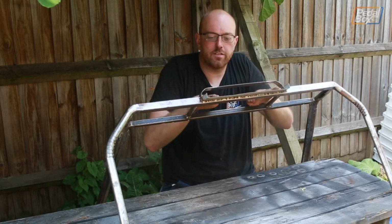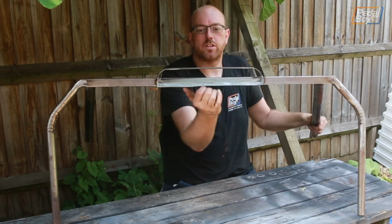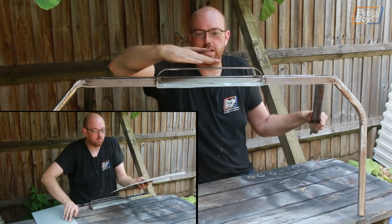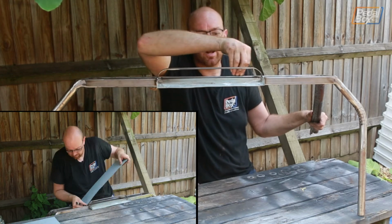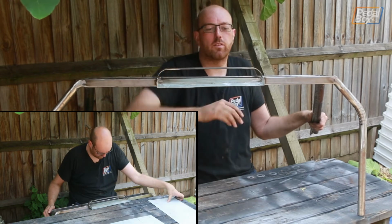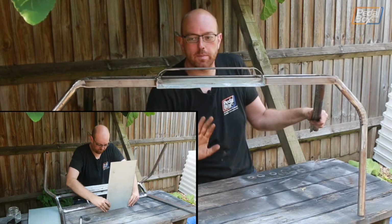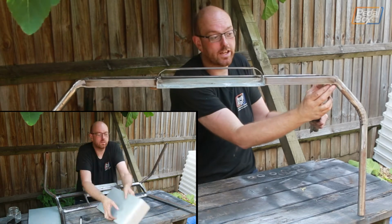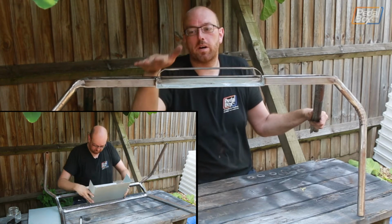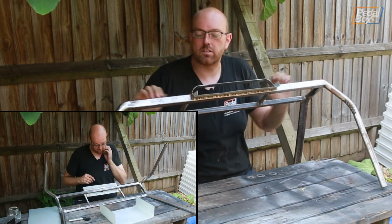Now we've obviously got the sheet in the very bottom here that you can see, and that forms the bottom edge of the scoop. Now, it's not completely flat where we've been welding through, but basically the top edge of this needs to come down and roll into the very back edge of this framework, and internally this needs to roll down, and this will probably have to be cut a little bit and bent down slightly so it gives a slightly better scoop, but we have got the roll cage running through the bottom. So it's not like this can just drop straight in, but we need to get this part in first, and then we can continue further out and add on the side panels out here.